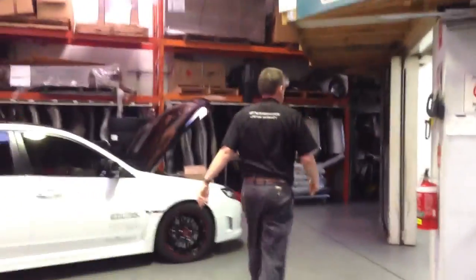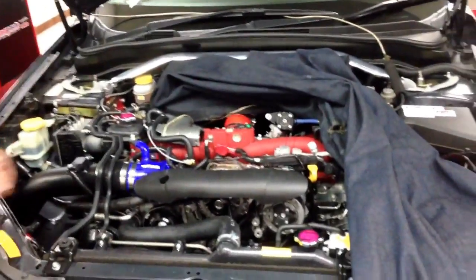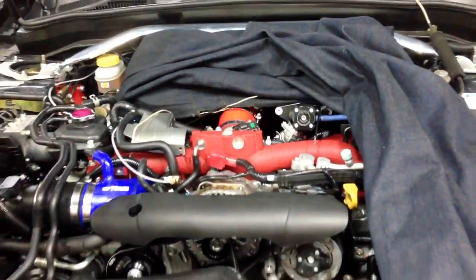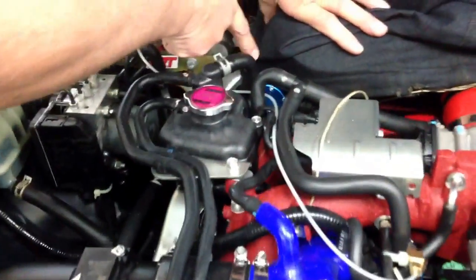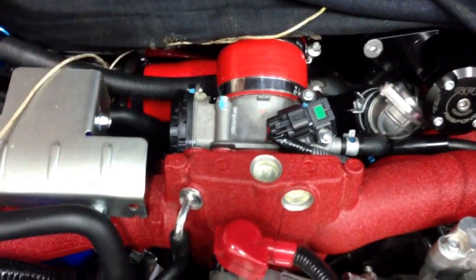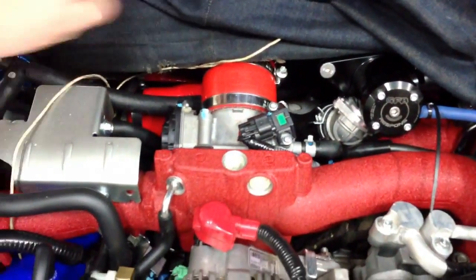Follow me around into the dyno and we'll show you the recently dyno-tested STI. This is a MY08/MY09 four-door STI sedan. You'll notice straight away it's got an aluminium cast alloy inlet manifold, an MRT top mount intercooler, and a GFB blow-off valve. Most notably we're using a Tomei silicon intake pipe to another Tomei turbo as well. You'll notice here this is where the aluminium inlet manifold has the throttle body — remember on the plastic inlet manifold on the WRX it's tucked down underneath because of the different orientation of the intercooler.